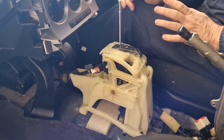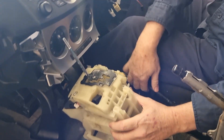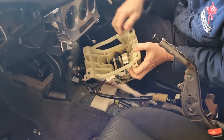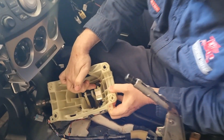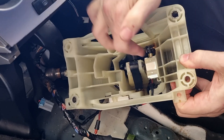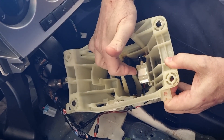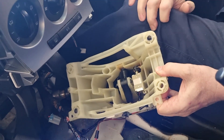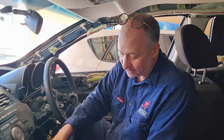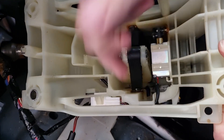This person was asking how easy or hard it is to change the solenoid in this structure. I've taken the four mounting bolts off the selector and turned it upside down — that is the solenoid right there. When I put my foot on the brake you can see the solenoid activating. If the solenoid failed, that's the part. The question becomes how easy or hard it is to change, and the answer I've come to is it's damn near impossible to do it at a component level — because it's not plugged in; those wires are actually soldered in.